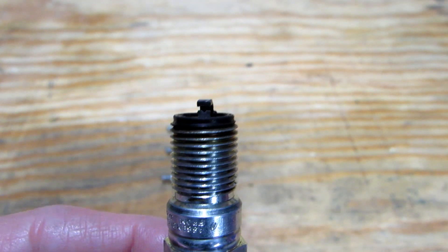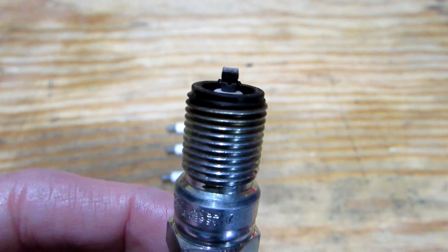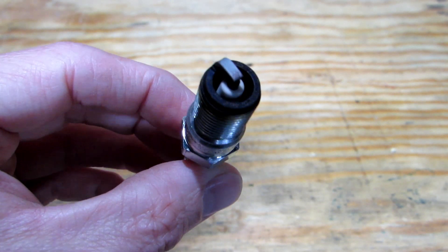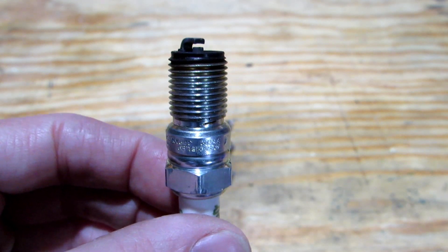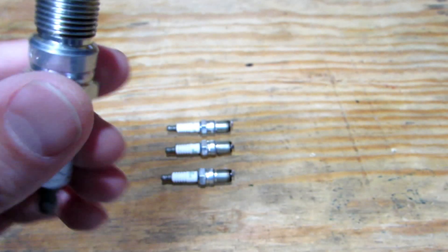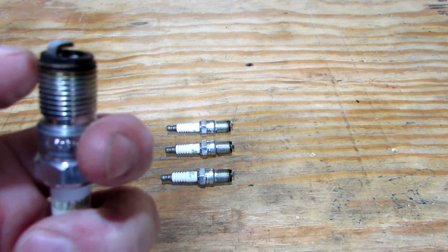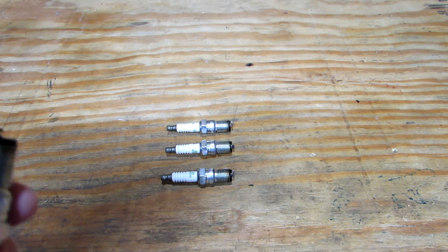You'll see a little discoloring on the threads about the second thread down. It's a little difficult to see, but you can see how it's shiny, and then the carbon at the top is black. But you've got a little bit of coloring on the threads — like a tan color, a couple threads in. That's telling you the heat range of the plug is good. If that heat went farther down, the plug's too hot; if it was clear with no marking at all, you maybe had too cold of a plug.